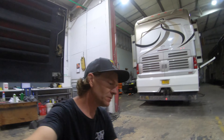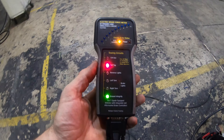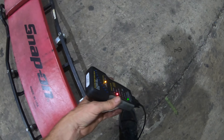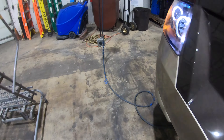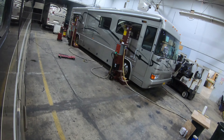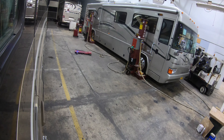This will be the last segment of this video. We've got the electronic brake force meter test. We've got this plugged in here — it doesn't have a 45-foot cable of course because it's made for new cars and pickups, so we'll set it here leaning up against the old creeper. The brake controller is lit up showing that there's a connection. So we apply the brakes, there's the level, and slide the handle across the bottom to simulate that. You can actually watch that light bar go up and down as you run the controller up and down. All tests out good.